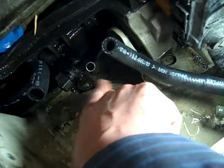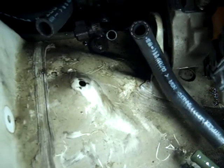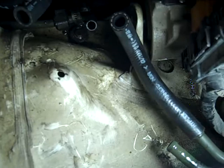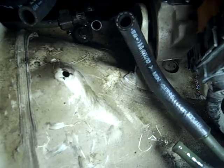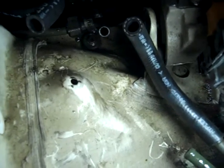Now, I can probably get by with using a straight piece of hose, but it's an oddball size — it's 475 thousandths, so it's smaller than a half inch. I could probably use a half inch hydraulic hose and compress it with a high quality hose clamp, but it is an L shape, and I would much rather get the factory item.